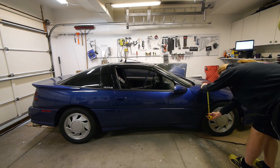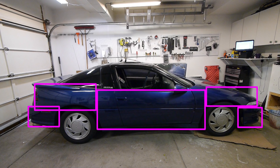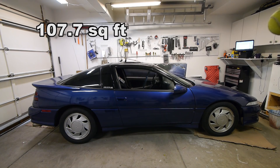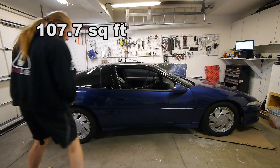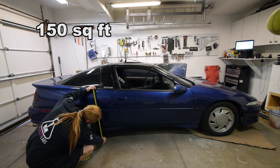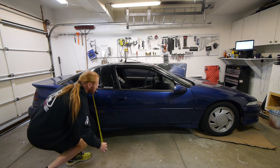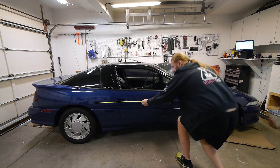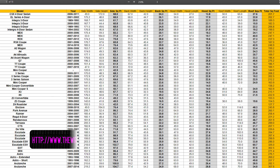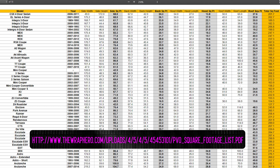So just how much does it take to paint an entire car? I did a quick rough blocking out of the square footage on my Eclipse — sides, fenders, trunk, hood, roof, etc. — and came up with 107.7 square feet for the exterior. I didn't measure things like the underside of the hood or fender edges, so let's round up to a nice even 150 square feet. Three coats of primer, three coats of paint, and three coats of clear on 150 square feet would add 138 ounces — which is 8.6 pounds. My official guess was four pounds, so I lose. I also found a chart online showing the average compact car is about 200 square feet, which comes out to about 11.5 pounds, though I can't vouch for its accuracy.